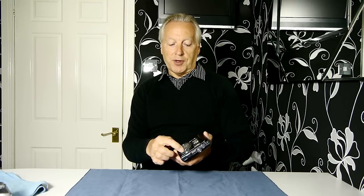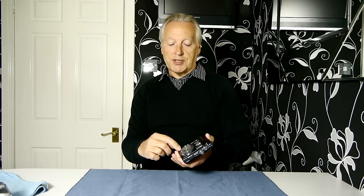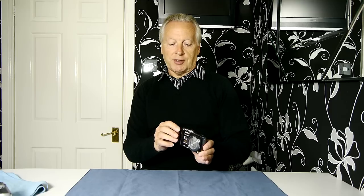So if you're storing this camera in your pocket, where dust collects around the inside ridges of the lens, then when you extend the camera that dust gets sucked into the lens itself. The most likely culprit is going to be the infrared filter which is placed in front of the CCD element, but to gain access to that you need to split the camera to gain access to the back of the lens. In this video I'm going to show you how to split this camera and clean the sensor and the infrared filter.